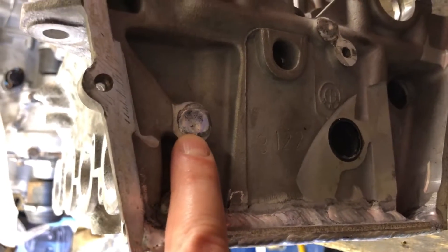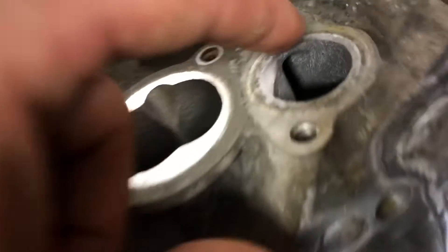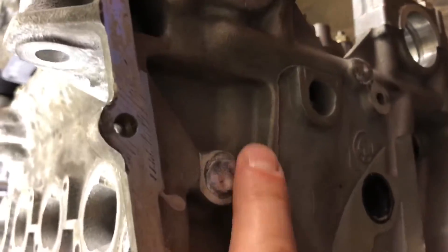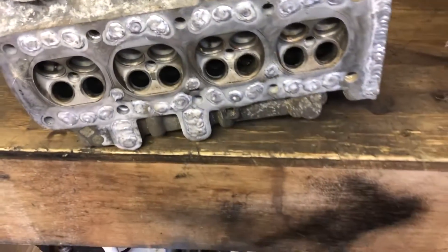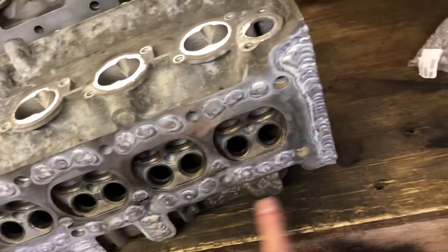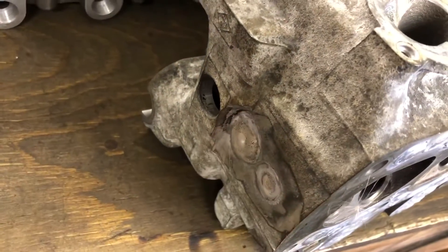Here is where you'd have a stainless steel pin for the tensioner — it sort of runs into the top of the waterway. If you don't weld that up, you can drill and tap it with PTFE and all that, but it's just easier to weld it up. So literally that is the head modifications required: that plate welded in, and weld up all of these. Because I'm doing a dry deck, this is why the waterways have been welded up at the end as well.